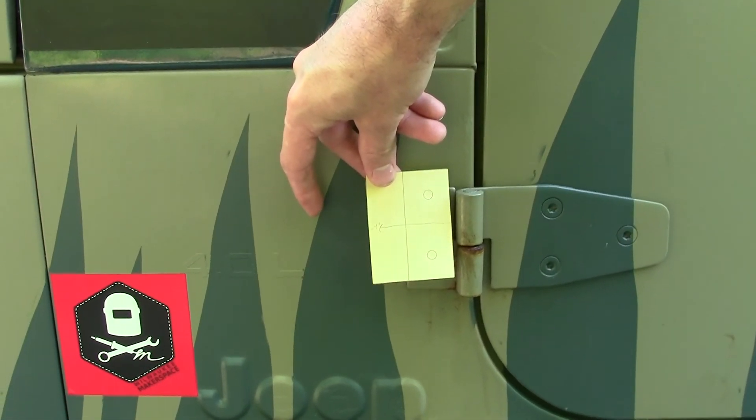This piece I've yet to cut down to size — I designed it and it was too long — but the general idea still holds true. It fits on just like that: square tubing goes right here, runs down and meets up with the other piece, then runs up to the top of the vehicle. From the top it runs across to the back, with a standoff over here so I can still work with my soft top, and then it either gets bolted right in here or runs down and bends underneath to anchor to the frame.